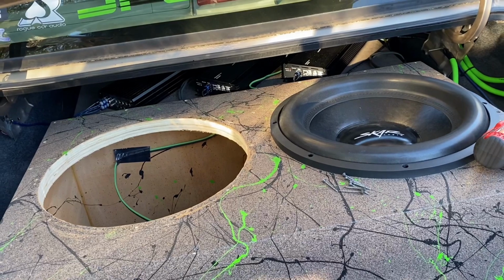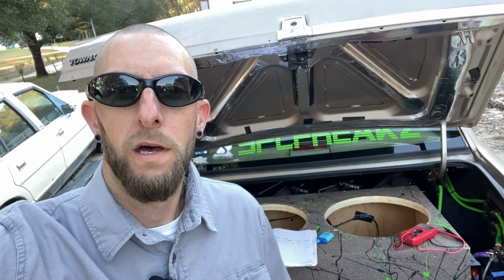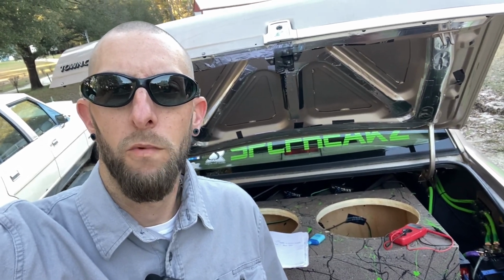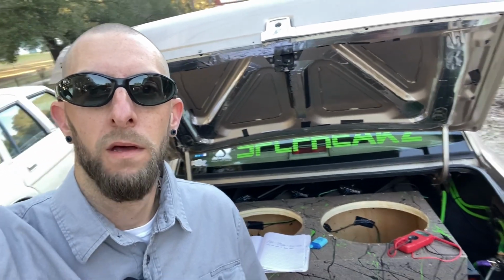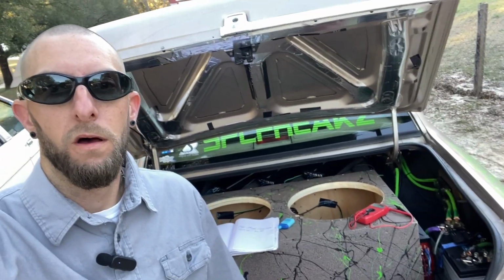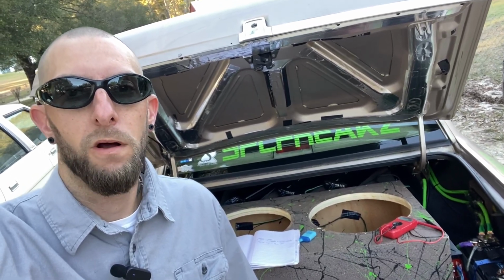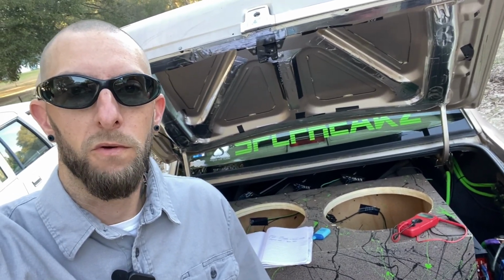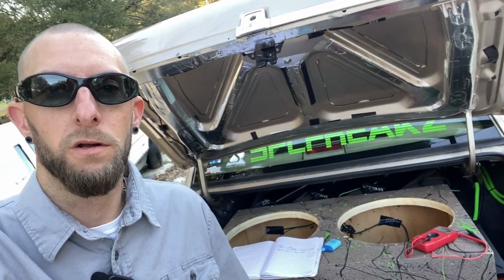So yeah. All right guys, I hope this video helped y'all. I know that's a way more accurate and better way of doing it. I should have showed y'all that the first time. But I hope this helps y'all on gain matching and on setting your power on your amps. Especially if you're running a bigger amp and a lower power sub. That'll keep you from blowing your subs.